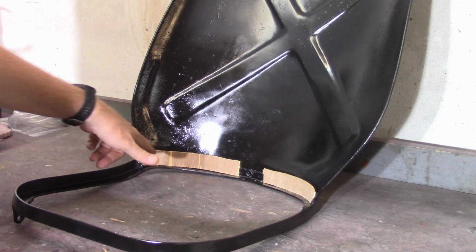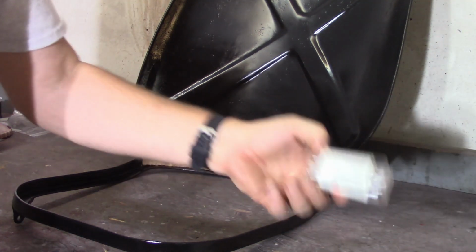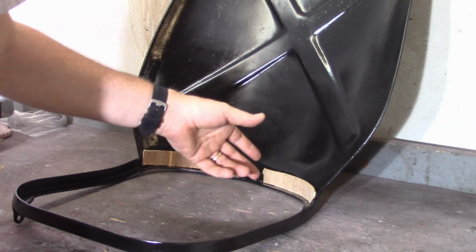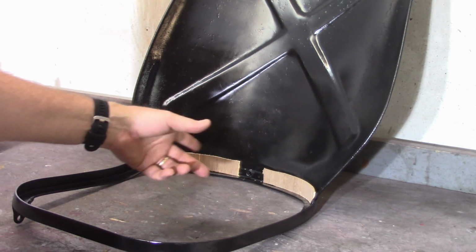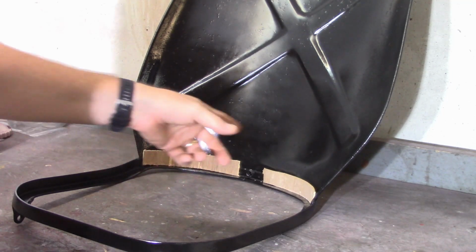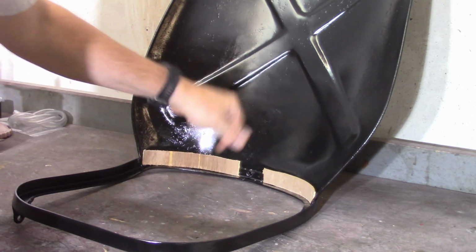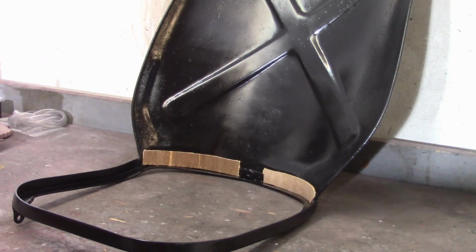The first thing you do is you put these tack strips in there, and they get pop riveted. Fortunately, the holes that pre-existed from the old rivets that I took out are about the same size. So I just got to drill holes in the wood here to make it easier, and then pop rivet, and that's what you use to staple the vinyl to.